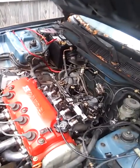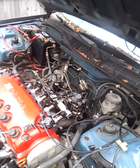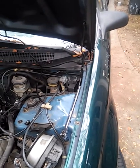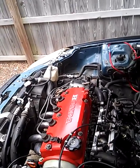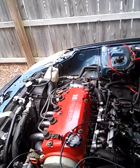But before you turn the car on, turn your air on hot. Turn it all the way hot, but turn your fan off. Don't turn the fan on. Leave your fan off. Then start your car. You can have somebody in the car, or you can do it outside of the car, but gas it at about 2,500 RPMs, maybe 3,000 RPMs, until your coolant fan kicks on, right? Then hold it there until your coolant fan shuts off, because it's going to turn on to cool the engine, then it's going to turn off.